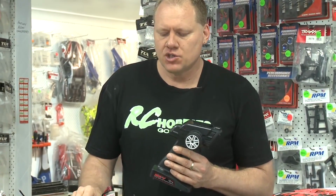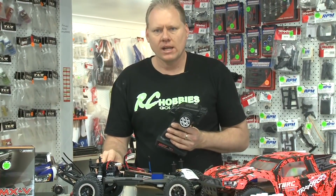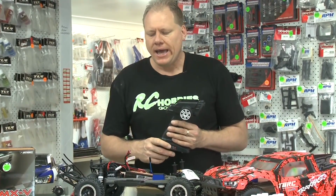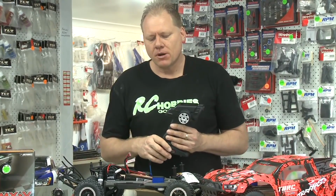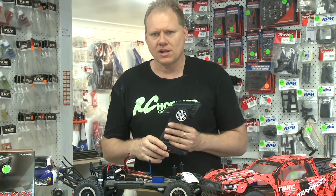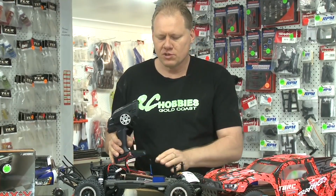At very, very low speed, this car will return a fantastic runtime. At low power, we're talking well over 2 hours of battery runtime on the 5000 lithium, probably more at the lower speeds. At full power, if you turn it up to maximum, I'd expect somewhere around 18 minutes. That's if you just held the throttle flat up and down the street and didn't back off. Nobody really drives like that, and there's no need for that because the cars are just that fast. So this is the remote control that we include with this package, okay?